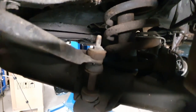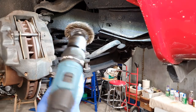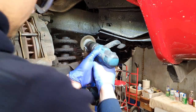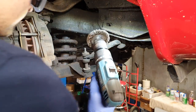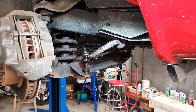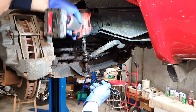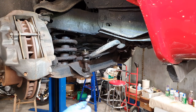I'm going to start by cleaning the thread and then undoing it and fitting the new ones on. I'll clean a little bit of the dirt and rust off so it comes off easily. That's nice and clean now. Let's spray some WD-40 maintenance spray. A 14mm fits perfectly on that — get the 14 at the bottom to hold it and a 14mm deep socket at the top. That's off nice and easy. When it's clean and there's no rust, it makes the job a lot easier.